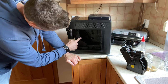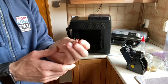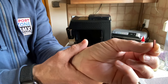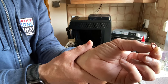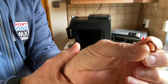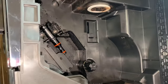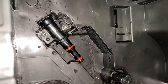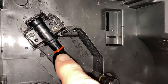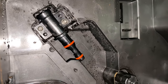Inside here there is a nozzle — I will bring the camera closer. On that nozzle there are two rubber seals. The first rubber seal, which I have already changed, is completely rotten, and that's only after six months of normal use. We don't drink too much coffee, and as you can see this thing was completely perished. That is the small part that I changed. Here is the inside of the machine — there's the nozzle, and the washer or rubber seal which I changed was this one here. You can simply pull it off with your fingers.